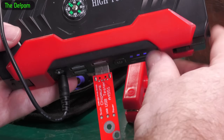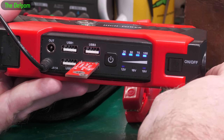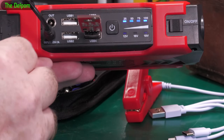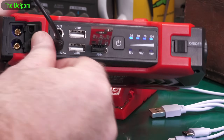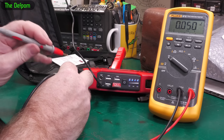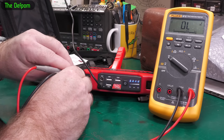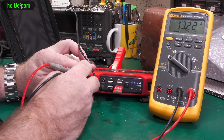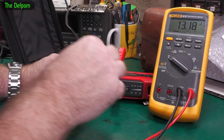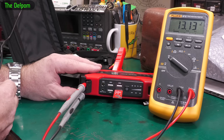I'm not sure if it's got some kind of internal fault where it thinks the battery is fully charged but there's no power. Maybe it's got a blown fuse internally - the fact that these aren't coming on is a bit of a clue. I'm going to leave this on charge for a little bit. I've got the jump start terminals here - let's just see if we've got any voltage on those. 13.2 volts - okay, so the battery is not completely dead.